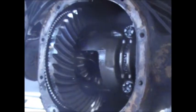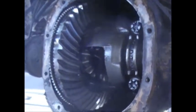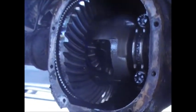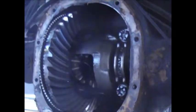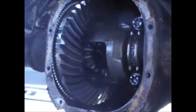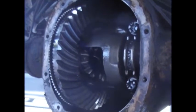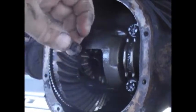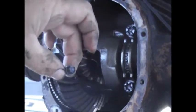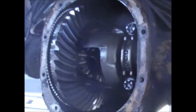Frustrated, I put some super glue on the end of a bolt, right on the little end there, screwed it in, and went inside to look at YouTube some more. About two hours later I came out and ever so gently backed that little bolt out with an eight-millimeter socket, and lo and behold the pin came about three-quarters of the way out of that hole.